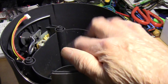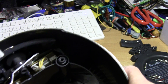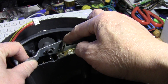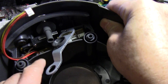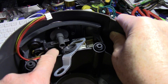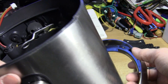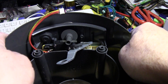After you've taken the motor out, you're left with the circuit board. Now I'm in the process of trying to take out the circuit board. You can see there's a little metal bracket — this holds the handle. When you move the handle up, there's an end switch; when you pull it up it releases the switch and the circuit closes so you can operate the motor.